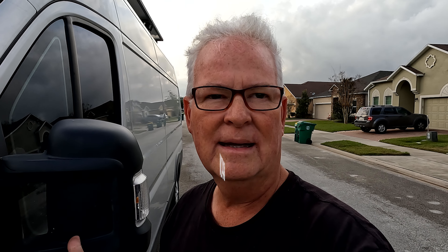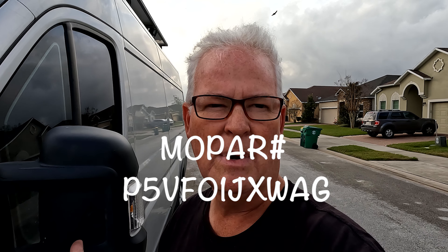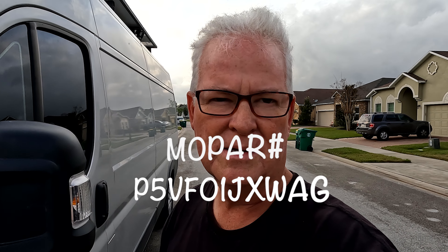Lucky me, it is a unit — I think the part number ends in WAG, the newest model. Our 2018 Ram Promaster — I don't think it matters what model, but we're on the 3500 extended 159 high roof. This has the heated mirror, the temperature sensor, power folding, and obviously power control of the mirrors themselves. When you hit the power button to fold it, these suckers fold in automatically and reopen when you hit the button. That just means when it's time to replace it, it's more expensive.